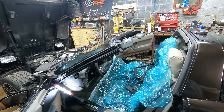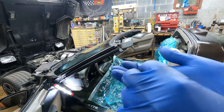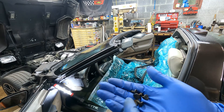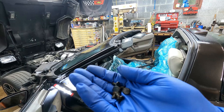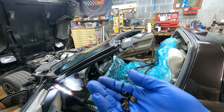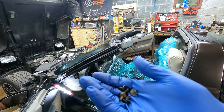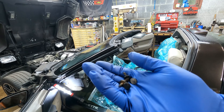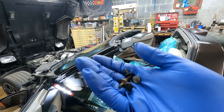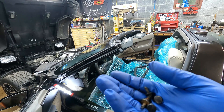I got everything cleaned up. I went ahead and touched up the corrosion and got the glue on where I need it. These little plastic push tabs are in such bad shape that I'm going to go ahead and replace all of them, which means I'm going to have to make a run to Napa. It's a little late for me to get there now. So what I'm going to do is put the weatherstrip on and hold it in place with screws for now, and then when I get to the auto parts store, I'll go ahead and replace those screws with the plastic push-ins.